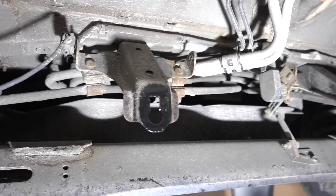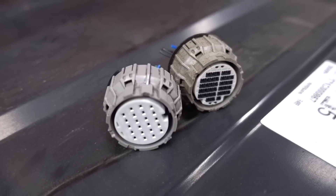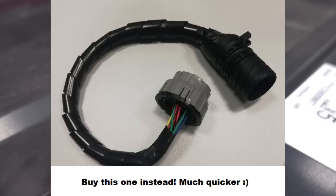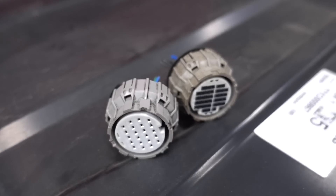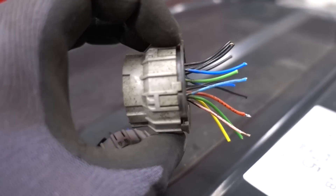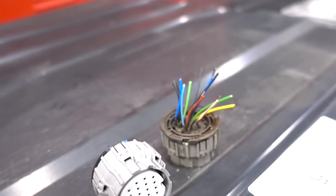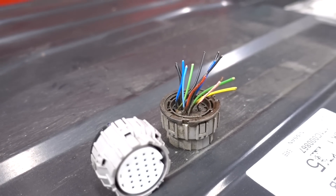Here are the brackets after being drilled out, with protective coating applied so they won't rust. The two communication plugs differ between generations: the older standard is a 22-pin and the new one is a 36-pin. An adapter cable is available for a plug-and-play upgrade, but today we're going for a budget version using a shortcut plug that came with the battery, which will be soldered onto the vehicle to save money since these connectors are usually quite pricey.